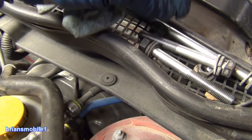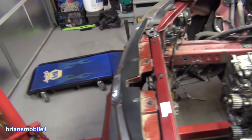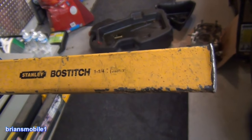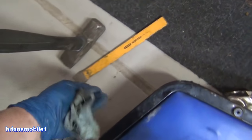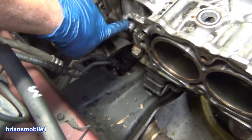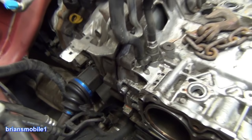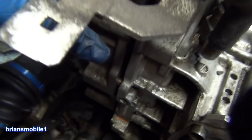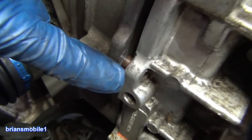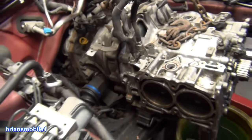You've got four per side, a nut at the bottom — don't miss that — these three bolts, and then on the starter another nut. Another tool I use that you wouldn't expect: a Stanley Bostitch inch-and-a-quarter chisel, nice and sharp. Get it in there, wackity-schmackity. I spray penetrating lubricant on each of the fasteners. It does chew things up a little bit — see this little chew mark here? This one was really stuck because it was rusted on.